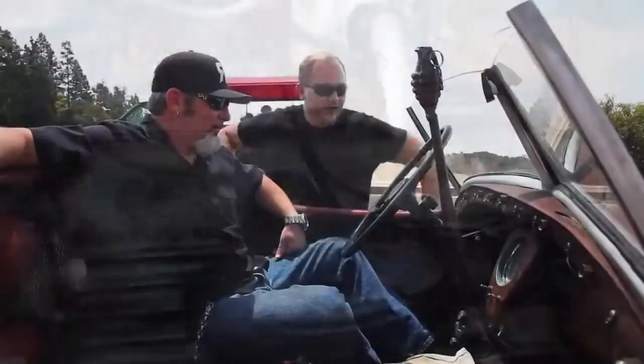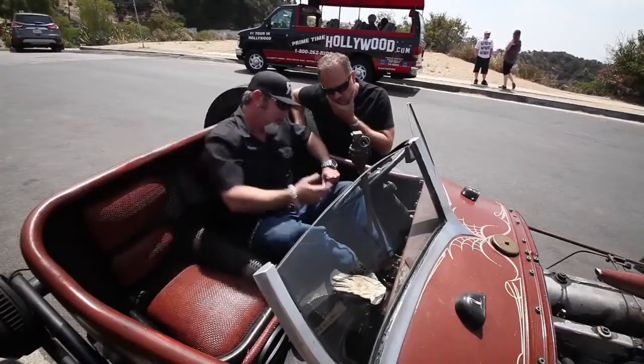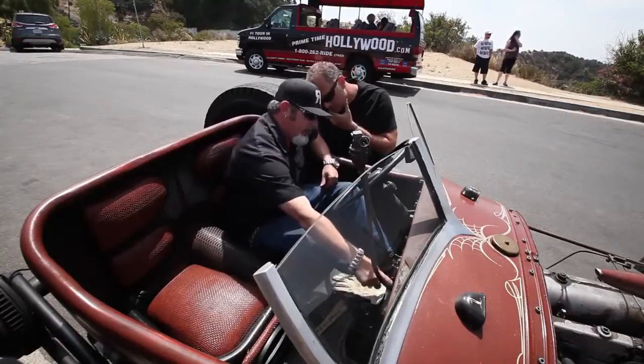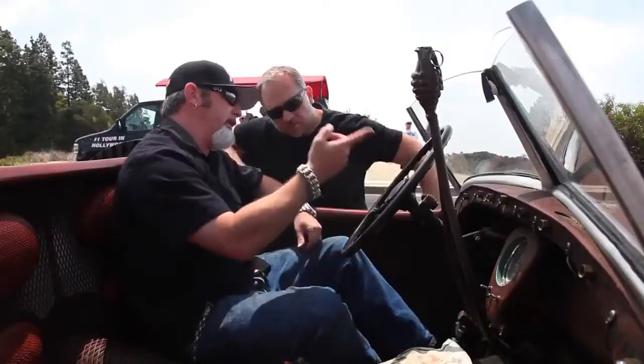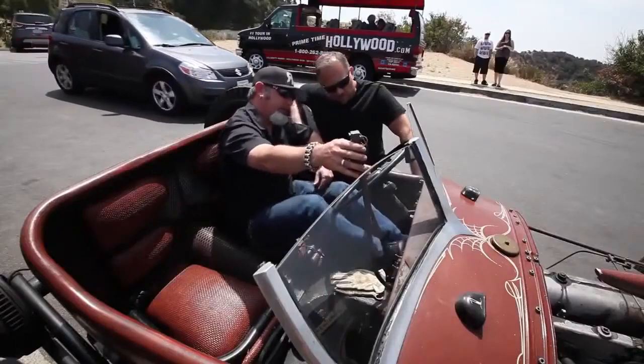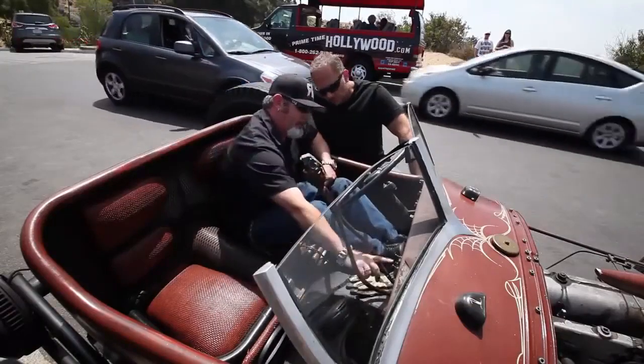So Henry, I'll be honest with you, I'm a little bit nervous about driving this thing. Take me through the process of what we've got, what the switches do, and so on. Okay. Well, you've got your standard clutch, brake, throttle. To start the power on the car, there's one switch. Lift it up. That'll turn on the pump for the airbags. It'll turn on the charging system. Then make sure it's in neutral. And it's one button.